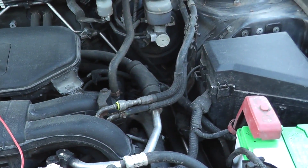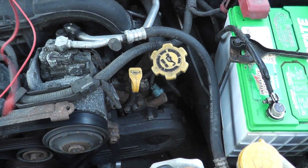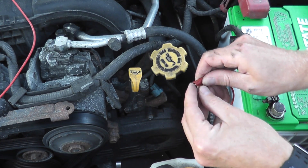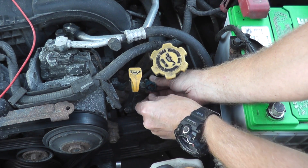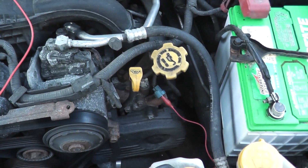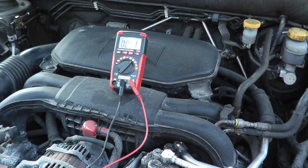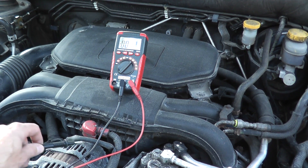Now take a look at the harness connector. What I'm going to be using is just a wire with two alligator clips — this just makes it a lot easier to do this test, not necessary but makes it easier. Just taking the end of the alligator clip — you have two prongs — I'm just taking the clip and touching the prong on the left. Make sure it seats in there nicely. Then going back to the multimeter, I'm just making the connection. The black wire from the multimeter is going to ground — that's any good metal point, something like the alternator for example.